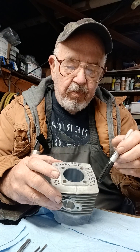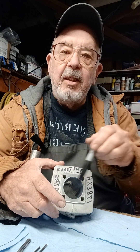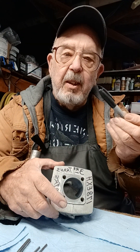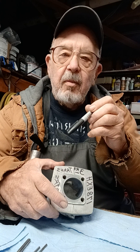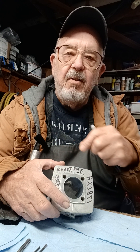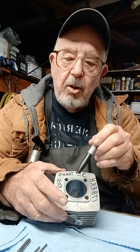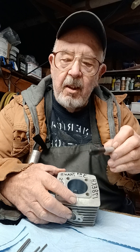Now once you've got your mark inside for your exhaust — this one I marked at 178 degrees with my sharpie and I verified that twice before I pulled it off the engine. So then you start your porting.